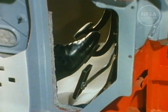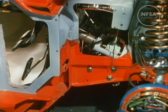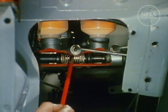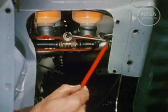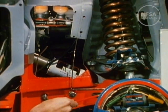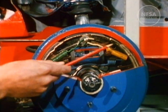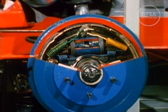When the brake pedal is pressed, power is transferred from the pedal to the brake shoes. A pump known as the master cylinder forces brake fluid through tubes to each wheel cylinder. This forces the small pistons outwards, expanding the brake shoes, and the brake linings come into contact with the drums, stopping the wheel.